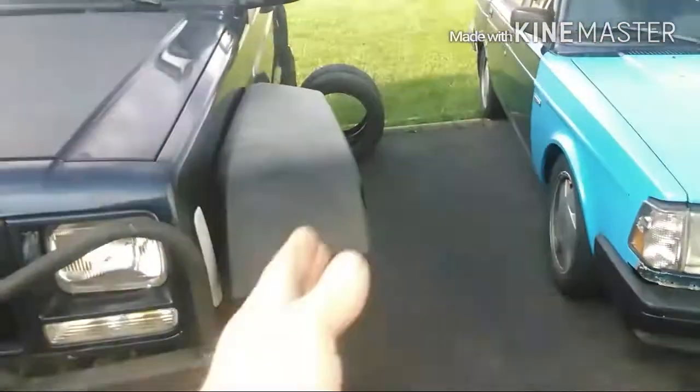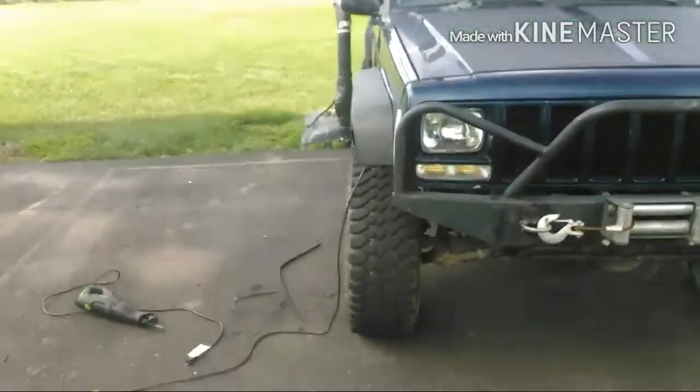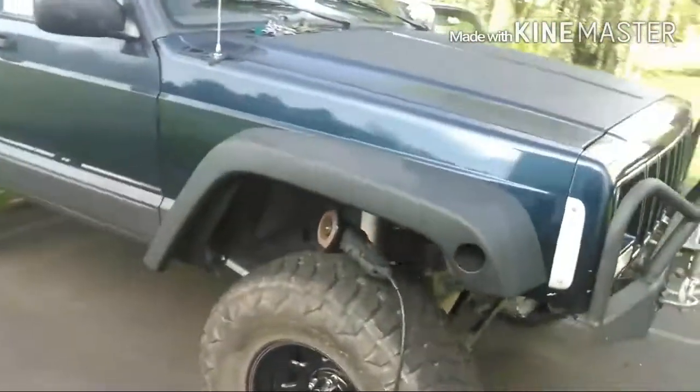to slowly bring it in so that this sits even with the side. And then once I had it pretty straight, I cut it back, I think 2 inches, to where it was not sticking out super far but still giving me good tire coverage. The key is, since there's a lot there, leave a lot there and slowly work it so you can get it to fit real well.